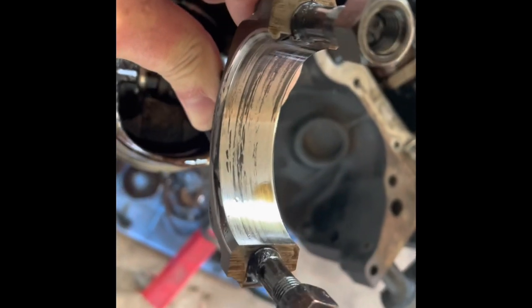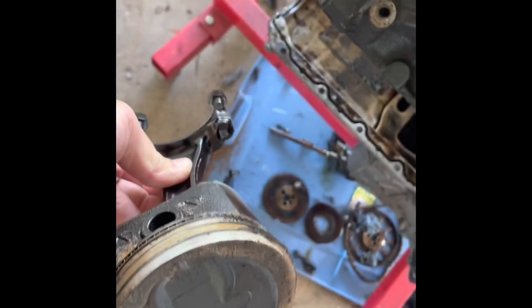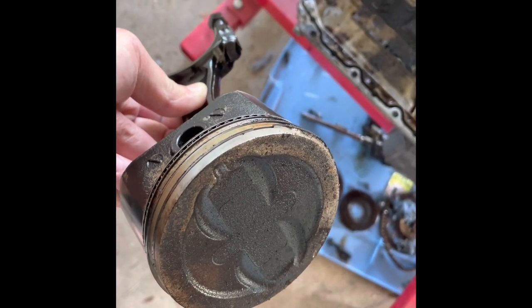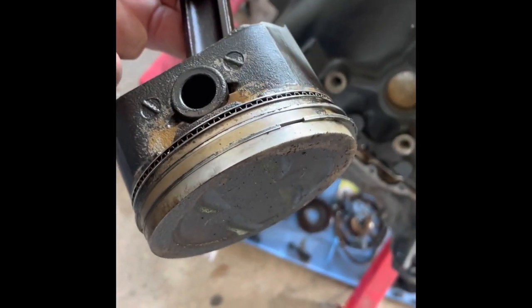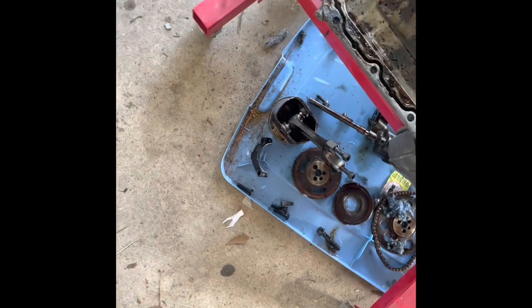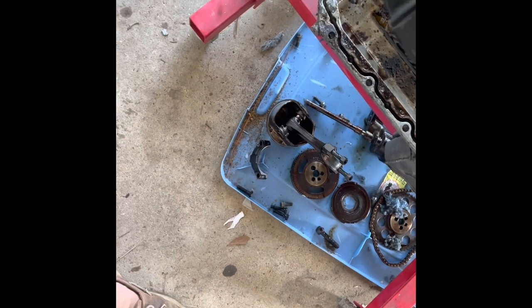You can see how the rod scored up right there. What happened is the bearing went, and then the rod surface and crankshaft surface ride on each other - it's just metal-to-metal contact. Even though you have some splash lubrication - like a lawn mower uses splash lubrication - if you've got that much of a gap you can't form what's called an oil wedge. An oil wedge is a very thin film of oil that creates a separation between the two metal surfaces to protect them. Once the clearance gets too high, that wedge breaks down and you have metal hitting metal.